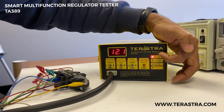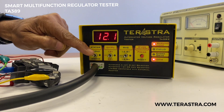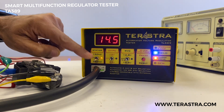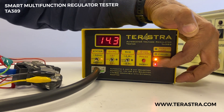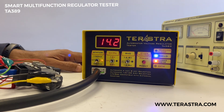You'll also notice that it's got a warning lamp. The warning lamp goes off, the choke drive comes on. So when the engine is functioning properly and the alternator is functioning properly and the regulator is charging, then the choke drive comes on. The DFM is flashing and all the other switches are right off.